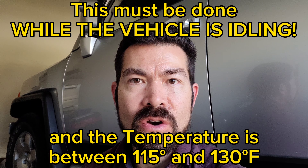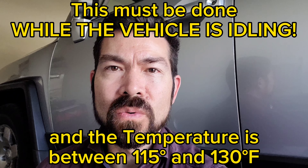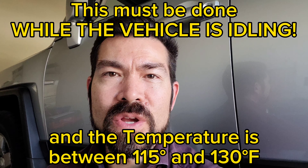With the overflow plug, the drain plug, and the refill plug all closed up, we're going to start the engine, run it through the gears, warm up that transmission, and then open up the overflow. If nothing comes out at that point, add another 0.2 quarts and try the overflow again. Continue doing that until you get a trickle from the overflow.